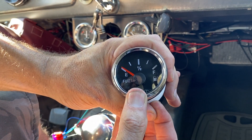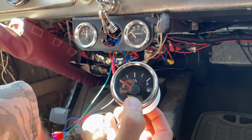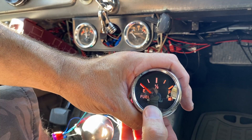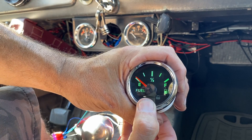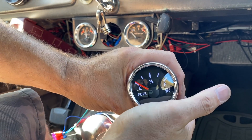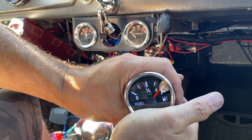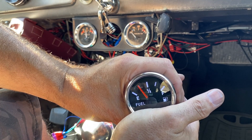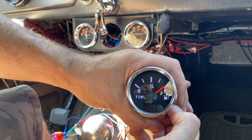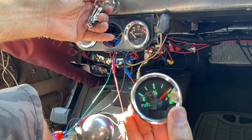You've got to press really hard. Well, this isn't working. Maybe I need to put the backlight on — let me try it with the lights on. Because all I'm doing is changing the colour of the backlight — it cycles through orange, purple, pink, off, green, red, white. Okay, I'm going to try again — hold it in for three seconds. Press it once: goes to full. Press it again: does nothing. Press it again: goes to empty. Press it again: goes to a quarter — ah, there we go, that's where I want it to be. Not sure why it's gone up to full. Very strange. Let me switch off the ignition and see if it resets to half.